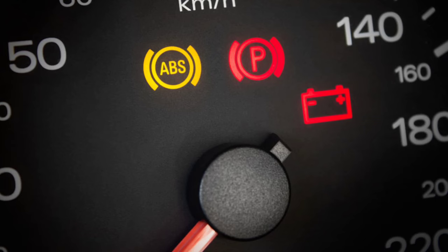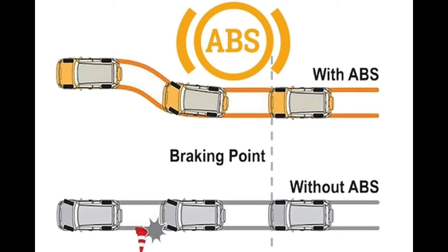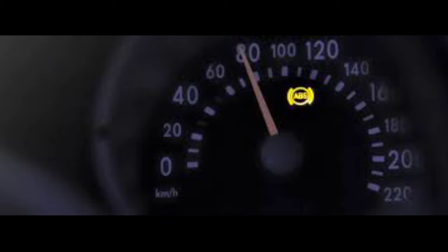How an ABS System Works. The main role of the Anti-Lock Braking System is to keep you safe from any accidents and to make sure that you do not lose control of your car, like skidding, in case of any emergency braking. The ABS is a safety system which has the ability to recognize a stop in the rotation of the wheels during braking while the car is still in motion, and release the brake fluid pressure which allows the wheels to start rotating again. The system is capable of this because it is fully automated. This operation may sound simple at first, but its importance lies in the controlled stoppage or slowdown of the vehicle while greatly reducing the chances of losing control of the car. This will allow the car wheels to avoid getting locked up and skidding uncontrollably.